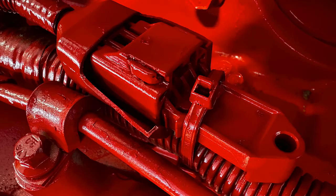This sensor is also very important for the turbocharger. As you go up in altitude, when you get to about 8,000 feet above sea level, it will cause a derate — no check engine light, but it'll cause a derate to slow down the turbocharger to keep the impeller from spinning too fast. Generally the intake impeller, which is made of aircraft aluminum, is the one that would explode. That's another purpose of the ambient air pressure sensor.